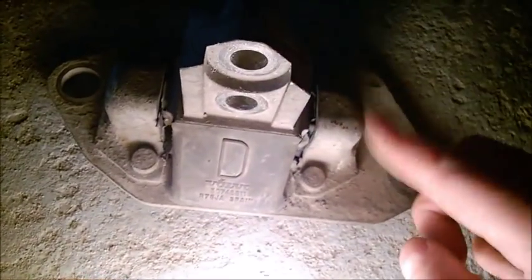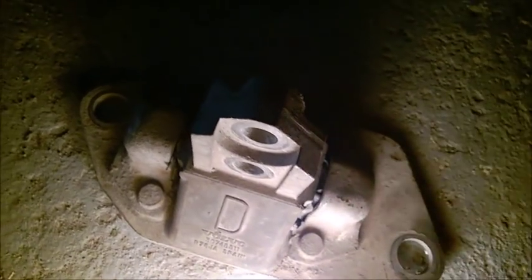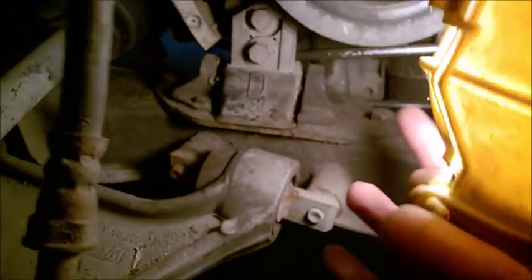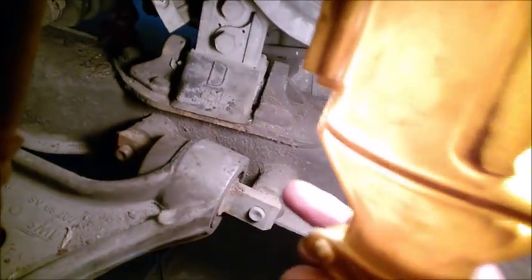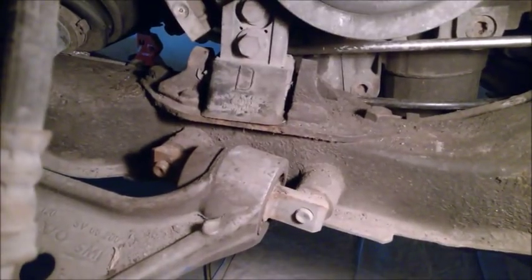Also this has a little bit different design, but it's still the same dimensions. This small bar here, which passes like this, sits at the normal height. The whole thing is not crushed downwards. So I'm going to replace this one, and it's not fun either, because the place is really tight to turn the ratchet, and those two bolts here, the lower one being inside the subframe, are corroded. And I know when I removed this one from the junkyard, these are really hard to turn. I will need a long extension, a long bar over the ratchet. These are really corroded and not fun to rotate. So consider this when lowering the subframe.